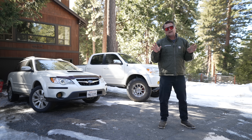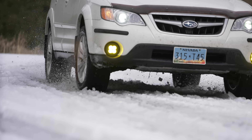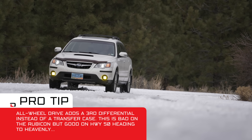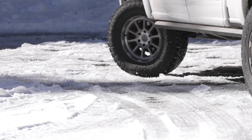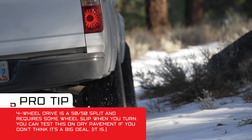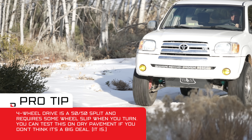The title of this video is a little click-baity. You don't even have to watch to the end. I will tell you which I like better: four-wheel drive or all-wheel drive. For icy roads, I'll take all-wheel drive like this Subaru Outback every day of the week. This has a viscous coupler in the center that provides power front and rear, with open differentials in the front and rear. What that does is it'll allow one tire to slip without things binding up. With four-wheel drive, if you have the transfer case locked, you can't really do that on a dry surface, and in a low-traction environment it can cause you to break loose. When the tires break loose, that's when you lose control.